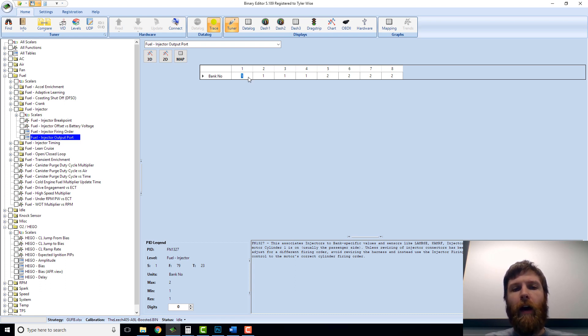When you think about it that way, you can divide your motor into a left side and right side — bank one and bank two. Bank one matches cylinder number one, so bank one is the four cylinders on the passenger side of the car. Bank two are the four cylinders on the driver's side. So let's say as an example you put your wideband on your driver's side — now you have to make all decisions on the passenger side. Passenger side is bank one. So we can leave those four alone, and just go into the other four and set everything to bank one. Now all of the fueling decisions are made based on reading that O2 sensor you've left in, and everything generally still works.